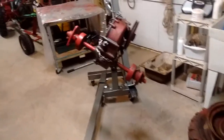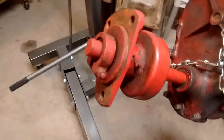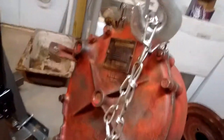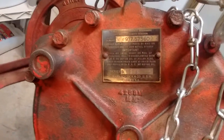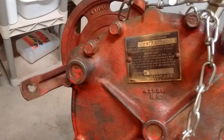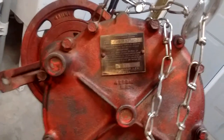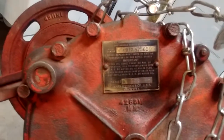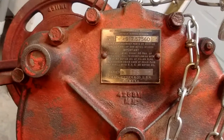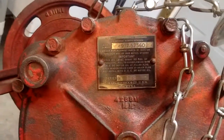We're back in the shop part of my barn. I'm getting ready to put this one on this table where I can finish cleaning it up — you can see there's still a lot of grease and dirt. But the transaxle, for the most part, is about 90% clean. This is the acetone I was using the other day to clean the manufacturing tag, and you can see it did a good job. I used a brass brush to do 90% of that — it's a good way to clean when somebody has painted over the manufacturing tag.